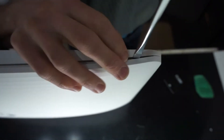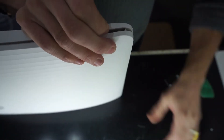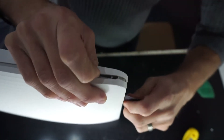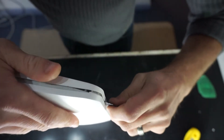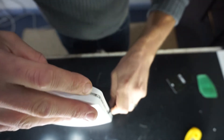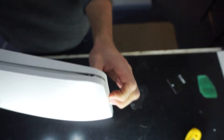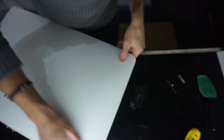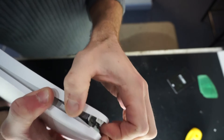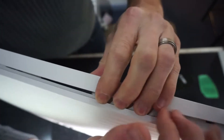To begin with, I did try and use a flat plastic pry tool with not much luck. In the end I found more luck with just a Phillips head screwdriver in a corner — put it in between the plastic and twist, and that did pop it open fairly easily. From there I could proceed with just a plastic pry tool and work around the display itself. On this one the screen lifts up and away from the back, rather than the back coming off the screen. Do note there are a few cables connected that you'll need to be cautious with when lifting the screen away.